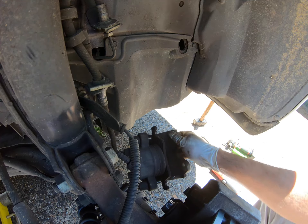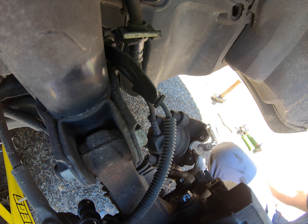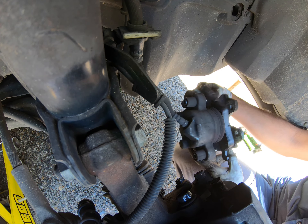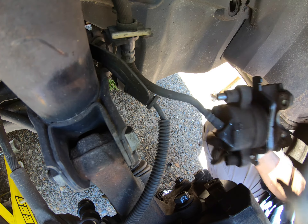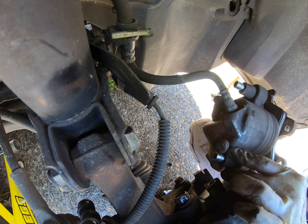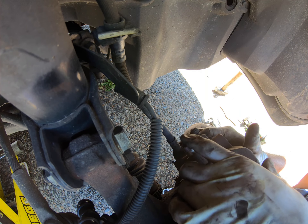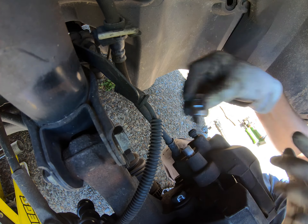Back to our brake pads — let's get this old one off and install the new one. Those little pins with the thread at the end, where you use your hex bit tool, you might want to grease those guys up, as that's what helps it go back and forth. I'm not showing you on this, but you know those little grease packets that they sell? That's where those come in handy.